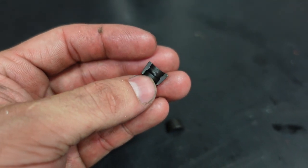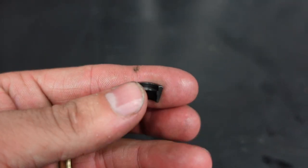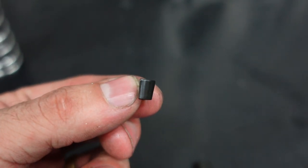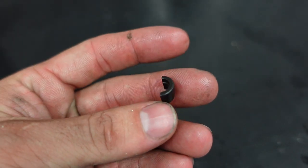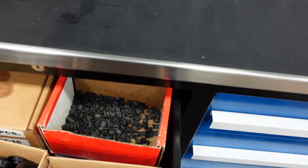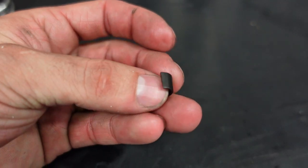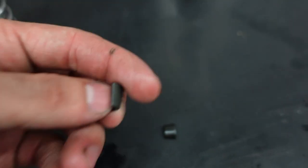A lot of people think that the little groove in there is what physically holds the valve spring onto the valve — you can see that receiving groove. However, that groove is no more than a locator. What actually holds everything together is the machined angle on the side. Basically everything gets wedged inside that retainer under spring pressure, making a friction wedge to hold everything together. On really high pressure spring setups you'll see that degree start laying back. These small lightweight LS keepers are 8-degree, and these big block Chevy ones are 10-degree — a little more aggressive angle of attack.